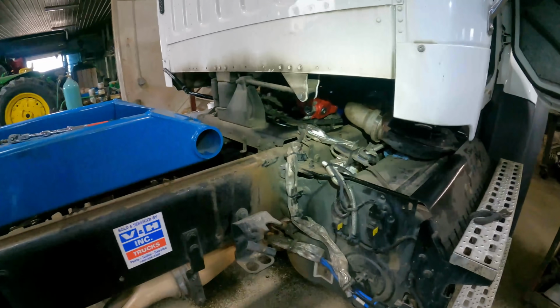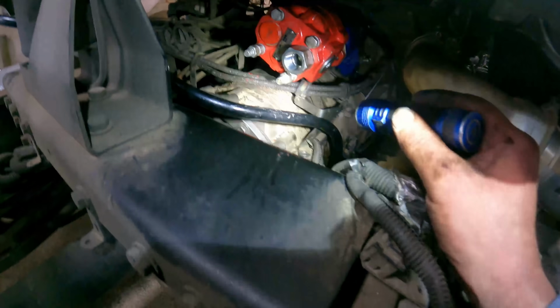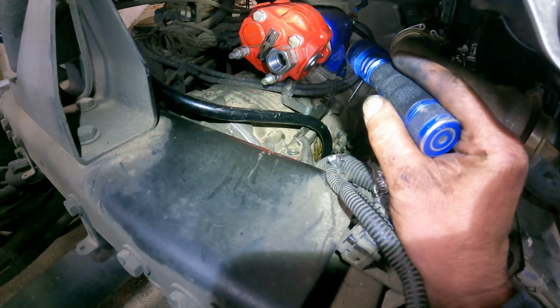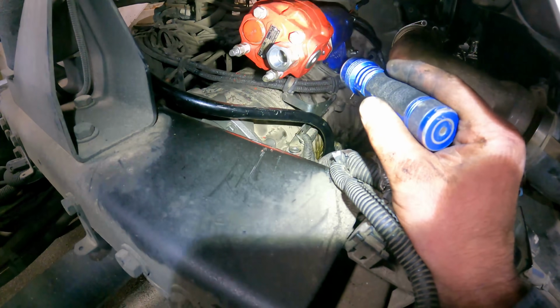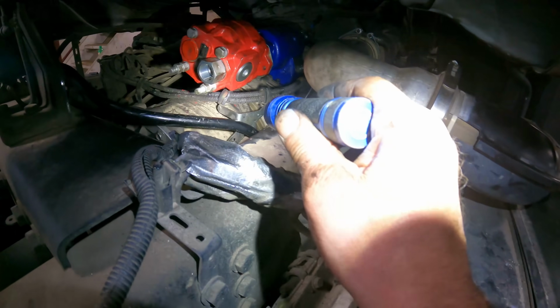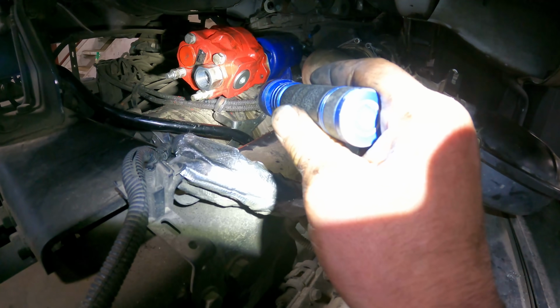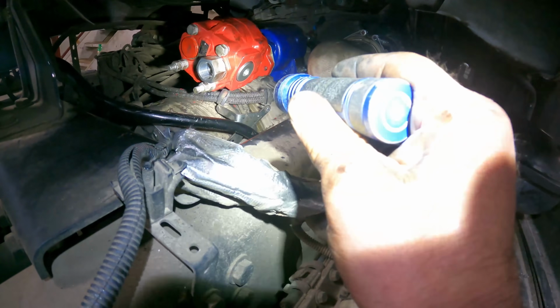So we're gonna work on getting that tube out now. All right, we've just kind of got the dipstick tube setting in there. I ended up pushing the pump up on the PTO. We've got all kinds of clearance. There's a main wire harness that goes down to the transmission that lays over the top, in between the pump and the transmission.